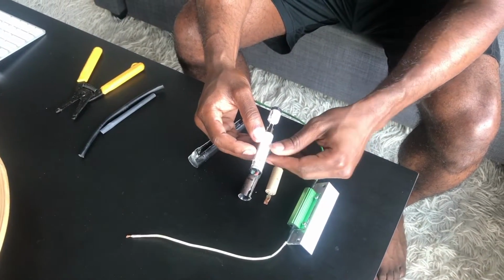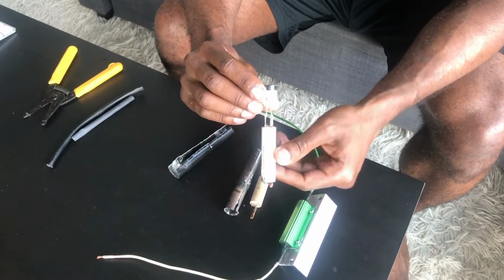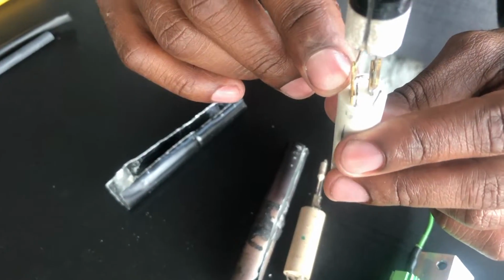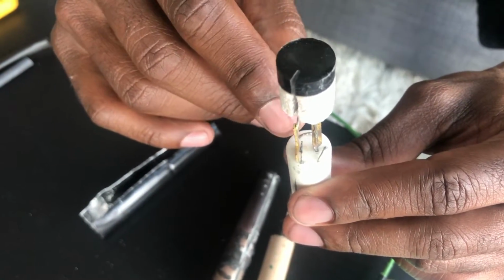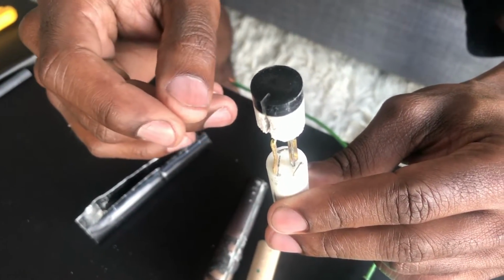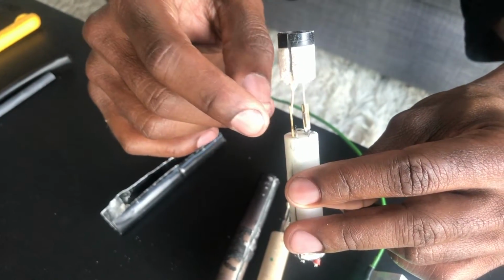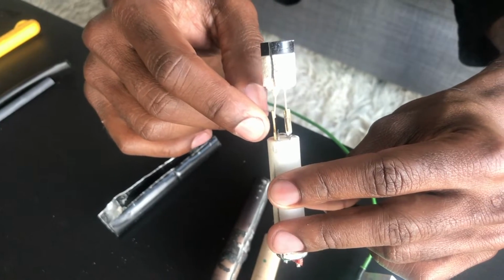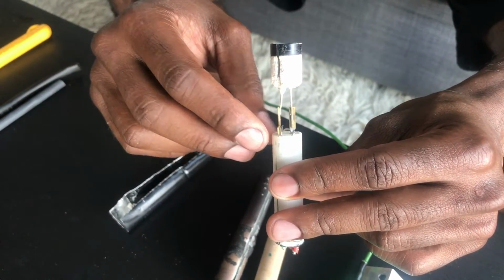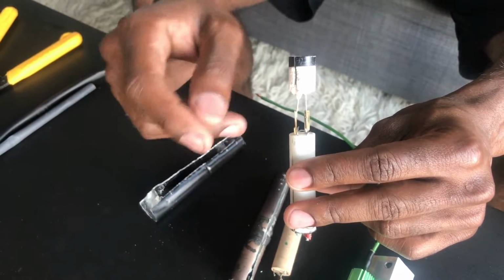The failure point that we found on the aftermarket resistor was that this spot right here where the nichrome is supposed to be welded to this lead failed. For whatever reason, I don't know if it was because it got too hot or it cooled too fast or whatever happened, this failed. And I believe that this was the weak link that failed in every fan that I had, because all my fans worked in high speed, but subsequently low speed would fail within 2 days to 3 weeks.